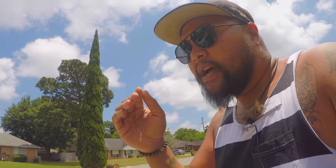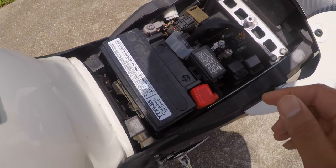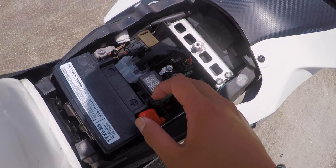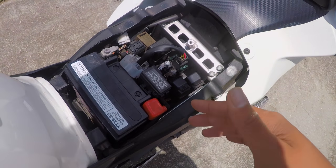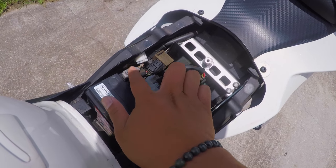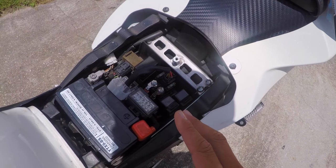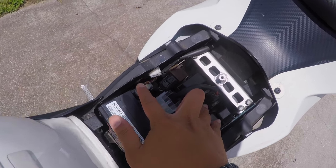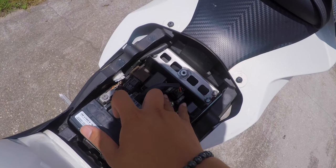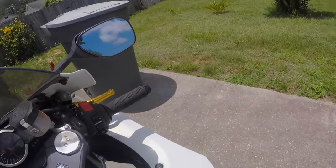So what I'm thinking is that the relay underneath the terminals is probably corrosion. The bike has 13,000 miles. That's the first thing I'm gonna do is switch that out. I did do a voltmeter check between here and here — this is one terminal and here — works just fine, I'm reading 12.5 volts. I check it from here to here — same thing, 12.5 — and then from here to here, nothing, which is how it's supposed to be. But when I connect these two together and try to start the bike, I get zero, which means these two aren't connecting when I'm hitting the start switch on the bike.